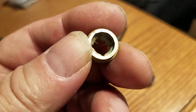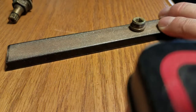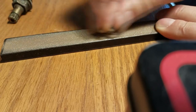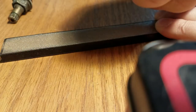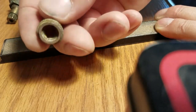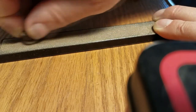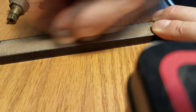Here's one that I started, and I still have a little bit of a groove right there. All I'm going to do is take this little valve seat and carefully rub it on my coarse sandpaper — in this case, a diamond file — until I get everything smooth across there. I've got that one fixed. That one needs a little bit more — right there by my thumbnail. The trick is you don't want to just grind it on one side; you want to grind it on all sides so it's nice and flat.